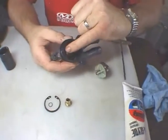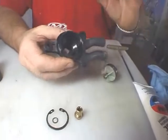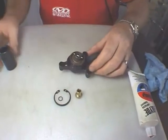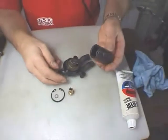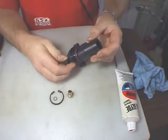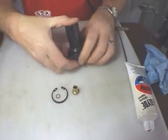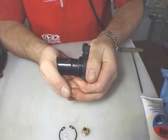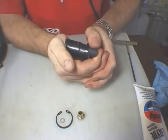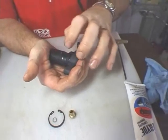Notice there is the snap ring groove. We'll be wanting to press the seal in just as far as it takes for it to just get past that groove. So obviously it goes in like this. I've actually found a socket that is perfect for using as a tool — it sits very nicely down in the seal and you can then press the seal in place. If you have any problems you may put this in a vice very lightly, but you can see that I can do it just with my hands. Again, you only want to press the seal just as far as it takes to clear the snap ring groove.